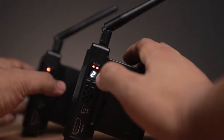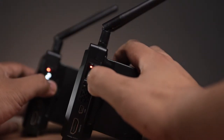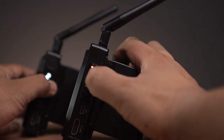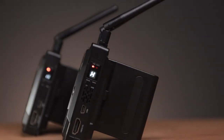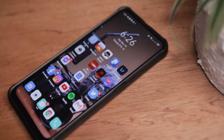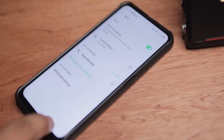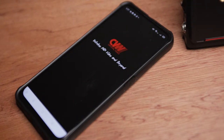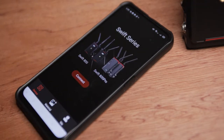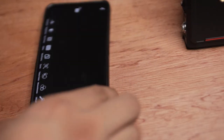Long pressing the mode button for 3 seconds will activate the WPS pairing process. You can also beam the video transmission to up to 3 smartphone devices. All you have to do is hold down the mode button on both the receiver and the transmitter at the same time until the lights from both units turn from red to green. Be sure to download the Crystal Vision wireless app, connect your phone to the WiFi of the receiver, and enter the password found at the back of the receiver. Then open the app, choose the Swift 800, and when connected, you can see the live view within the app.